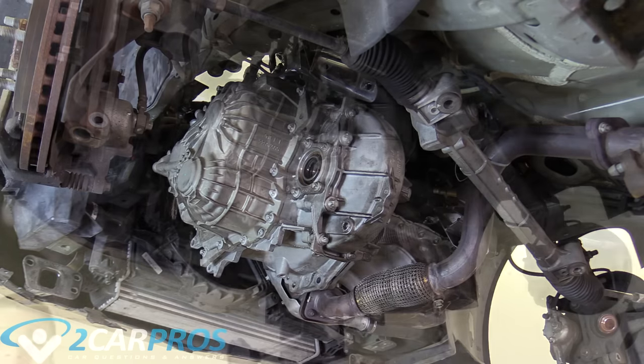As a side note — this is an odd flywheel. See how it moves — in my experience, it really doesn't do that, but this is a dual mass flywheel so that's normal. Now we can take a look at our new clutch disc here. We compare it to our old one that's falling apart and crumbling, and we want to make sure they're identical — same size, same basic construction, and the spline count is the same. This one is, so that's good.